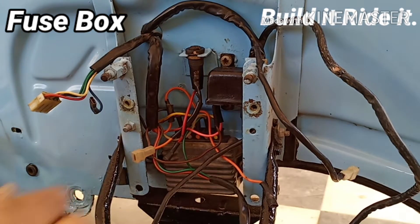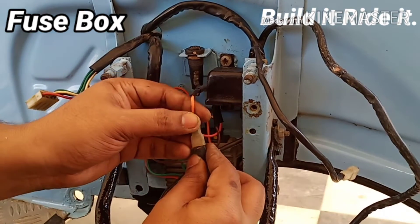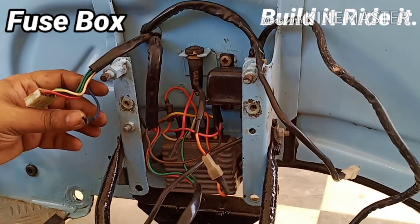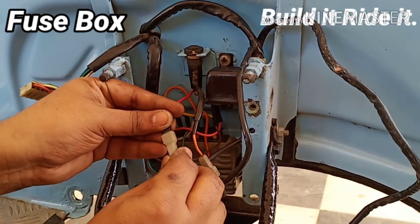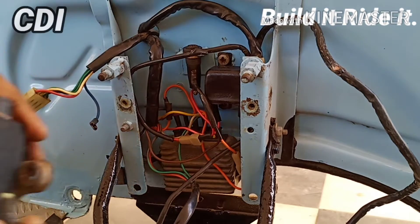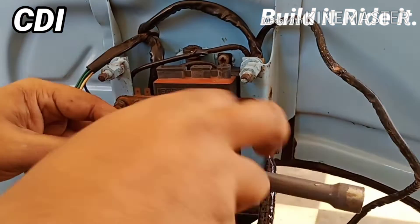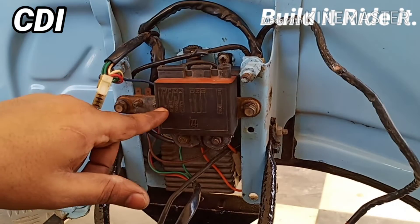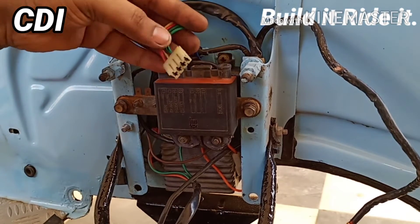That's fixed — it's a rather simple one. You have two lids left, you just have to place them back. The orange goes with orange as it should be, and the red one goes with the red. The green has to be here. The CDI unit still needs to be placed — red is written over here and likewise the last one is green. So here we have it.